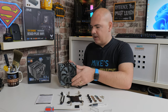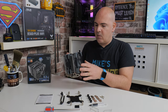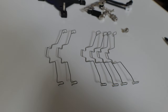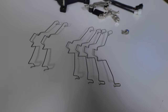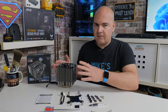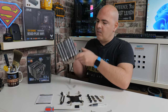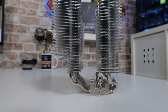It comes with spring clips to mount the fans — the 15mm narrow fan on the front and the 25mm on the rear. Both run at up to 1200 RPM, and there are an additional two clips included. So if you want, you can swap the front fan for another 25mm for a bit more power, or mount a third fan on the rear. You'll need to take VRM clearance into account if adding that third fan.